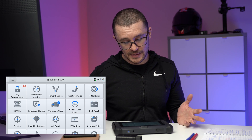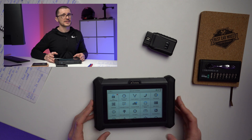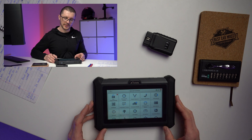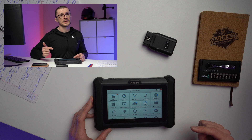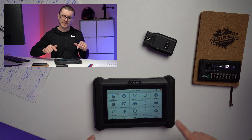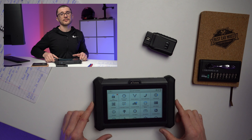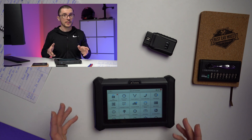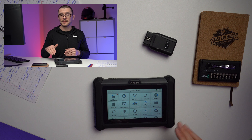The disconnect I found with this unit is that XTool is pushing out a lot of functions — functions that are not easy to perfect and that other manufacturers are staying well away from. This unit will allow you to do mileage correction, EEPROM rewriting with appropriate accessories but sometimes even without, key programming, advanced key programming, and things like adding keys to a CAS4 system, which is a little bit dangerous to do. But they are implementing it in their software, allowing the tools starting with the D7 family to do things like that.